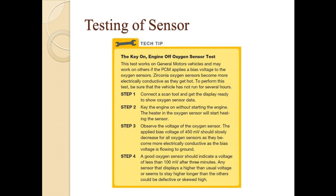When the output is read by the digital multimeter in step four, if the output voltage is around 100 millivolts or less after three minutes of continuous testing, the sensor is in good condition. However, if very high voltages are still being read after three minutes, or if it takes more than three minutes to drop to 100 millivolts or below, the oxygen sensor is damaged or not suitable for use.